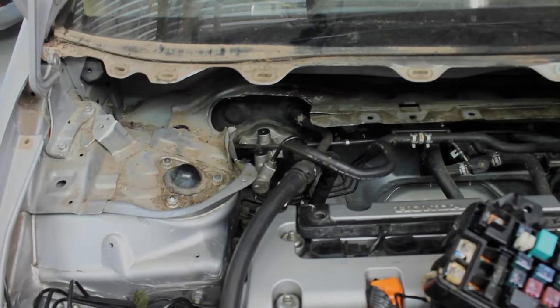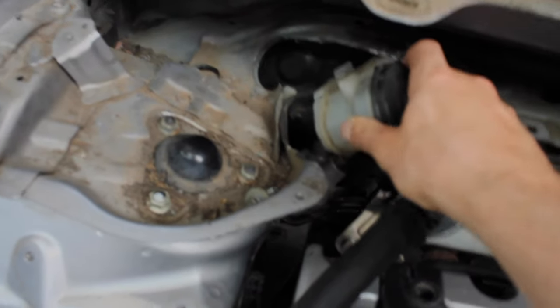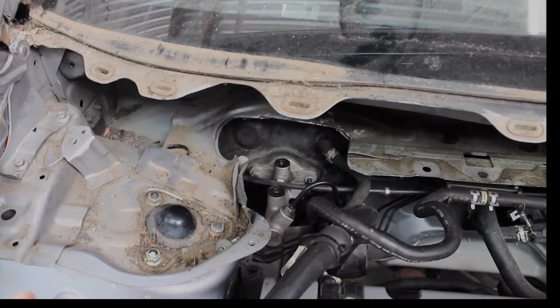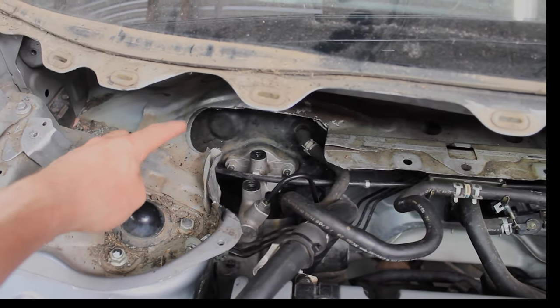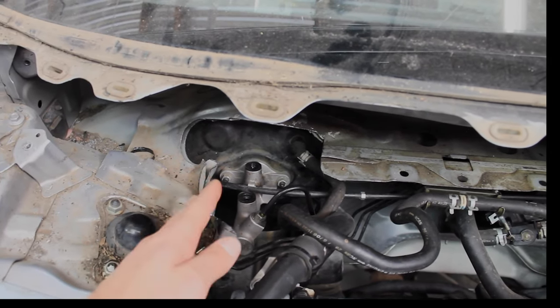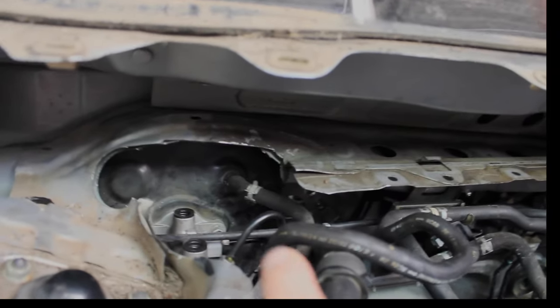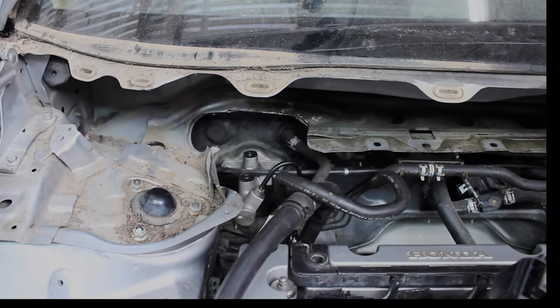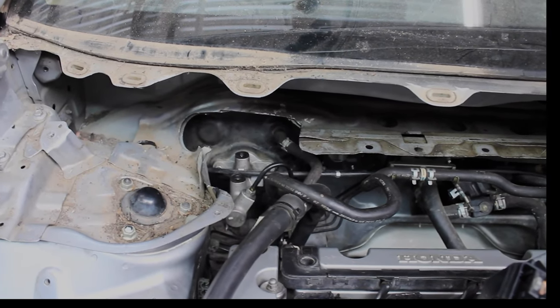The two pins - this one here and this one - don't match up, so it wasn't going to work. I could dick around and make something that works, but I thought we'll just get the angle grinder out and the tin snips and cut a big hole - just to make everything fit. So this reservoir now sits down in there. It's a little bit of a tight fit, but a little jiggling around and you get it in there. So I want to clean all this up, get it all ready, get it nice. I need to panel beat these two gaps closer together and clean up this edge - make it a bit rounded and fix this. So I'm going to jump into a little bit of panel beating, see if I can get it to sit how I want, and then we pull the welder out and we'll weld it up.